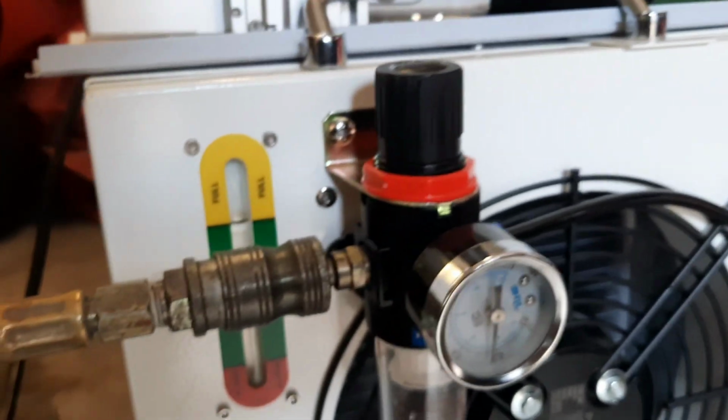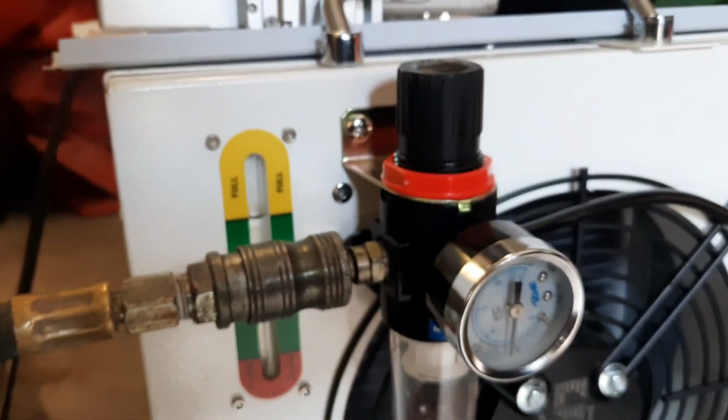About the same for spray painting. Well, that's what this is all set up for. Spray painting my airline and compressor. The compressor's back there through all those doors. So I have a regulator all the way back there. So I've just set that. And then you get a little bit of drop because of the length of the line. So I've just got it all dialed in perfect.